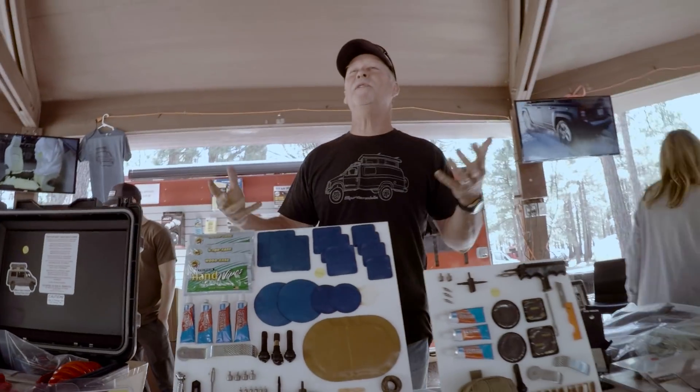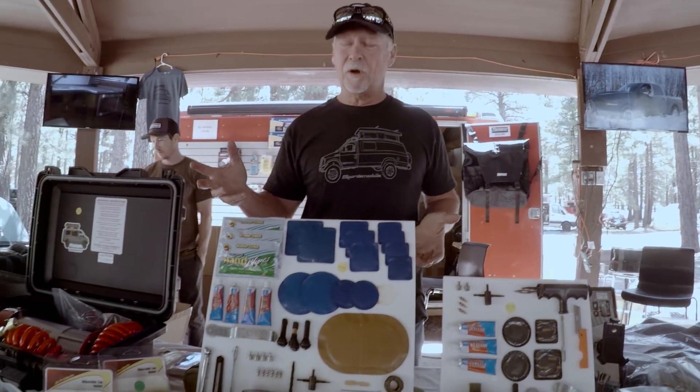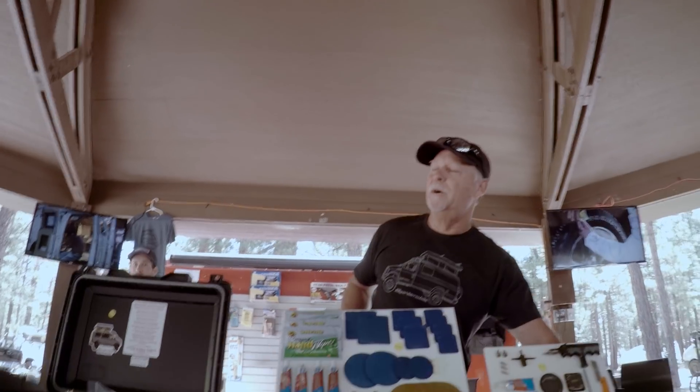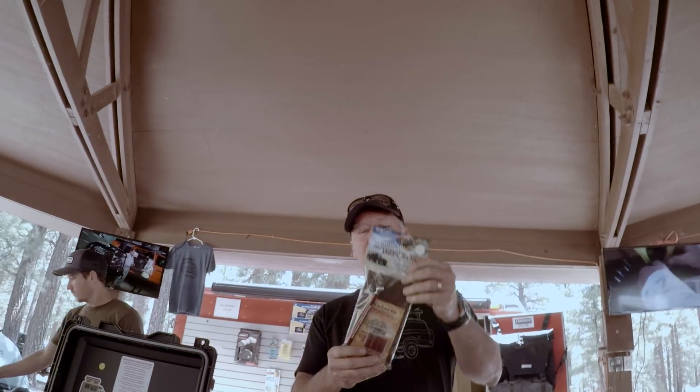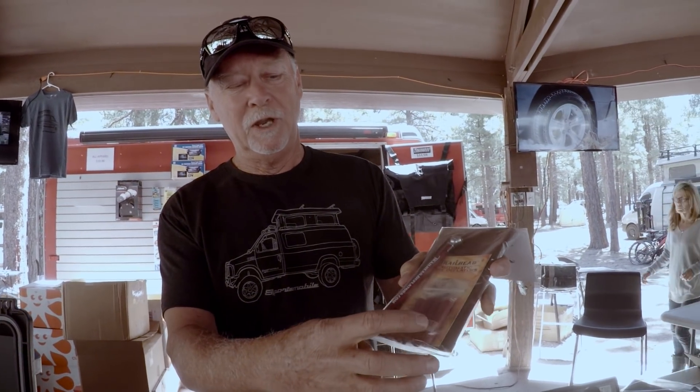What do I need this thing for? Having the van is just part one. What you really need off-road is air pressure — that's very important. To air down, I recommend these trail-ready deflators. You can set these between 15 and 40 pounds — I set mine at 30. You just screw them on each tire so it deflates all four tires at the same time, so it's four times faster.